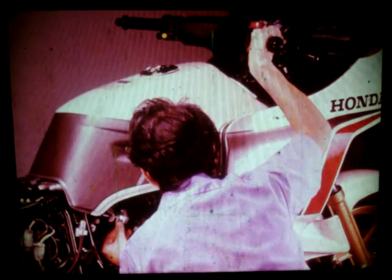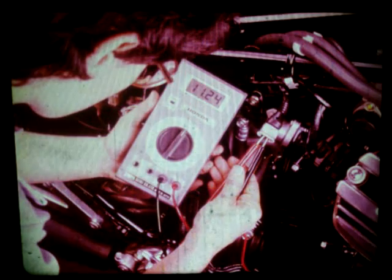To test a fuel injector, disconnect the good injector coupler. Turn on the key, quickly twist the throttle, and listen for a slight clicking sound at the test injector. If the injector doesn't click, you'll first test for voltage to the injector coupler. Connect a voltmeter to the injector coupler and turn the key on. There should be battery voltage available after 3 seconds.